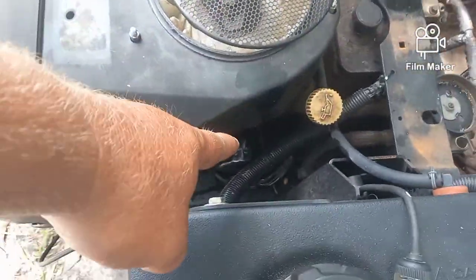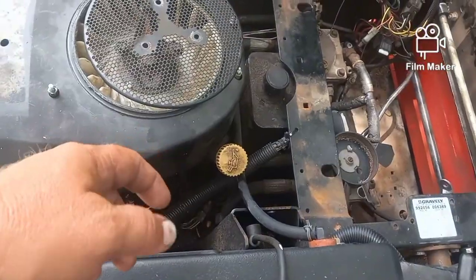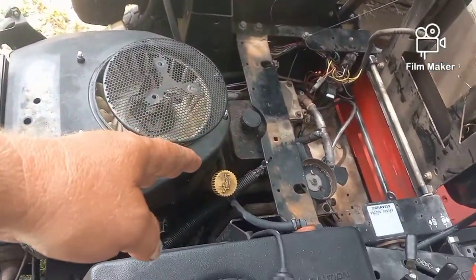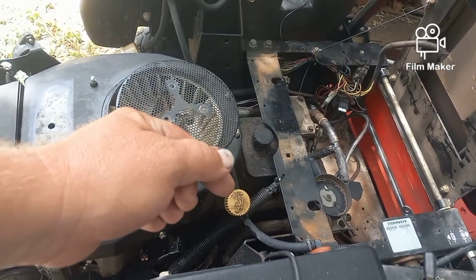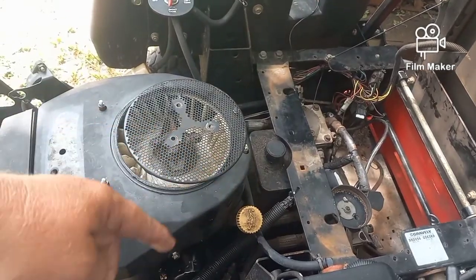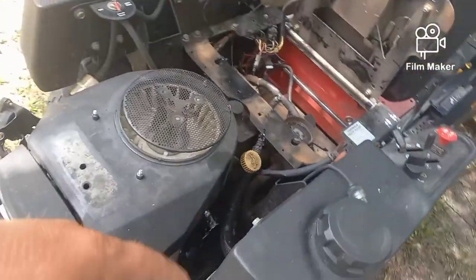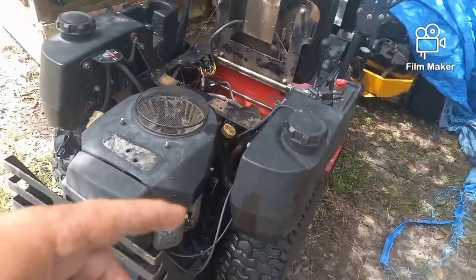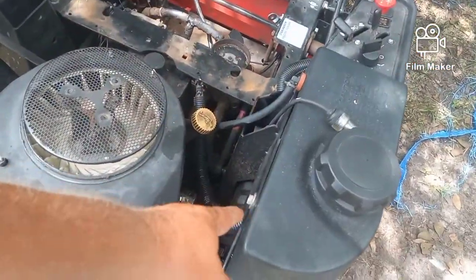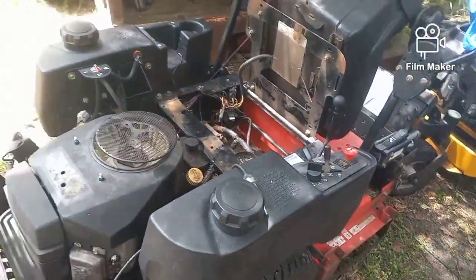The first thing was the oil filter. The oil filter apparently worked its way loose just a little bit. There's a rubber o-ring around the top of the oil filter, and what happened was the pressure built up and pushed the o-ring off. Because of that, it was able to squirt oil at high pressure out the side of the machine — it looks pretty scary, like a horror movie, with oil squirting clear across the entire distance.